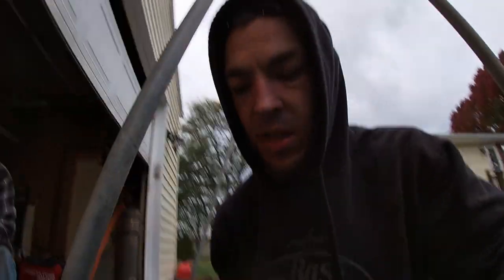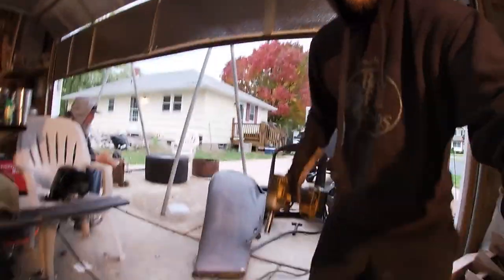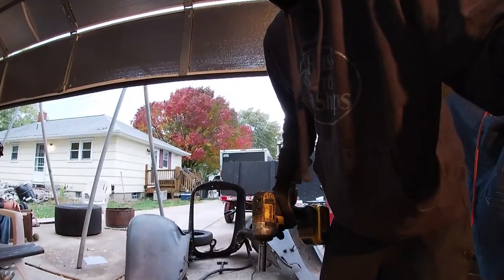It's really hard to see, but I'm using the plasma cutter and cutting just on the opposite side of the weld. When I'm cutting on the opposite side of the weld, where it's not a continuous piece of metal — where it's not 100% solid — the heat doesn't transfer into the back side of the other piece that you welded the two pieces together. I'm going to try to zip this apart before I get completely soaked.